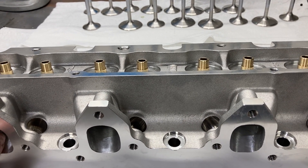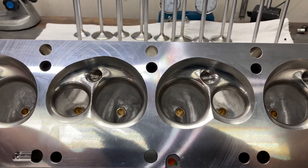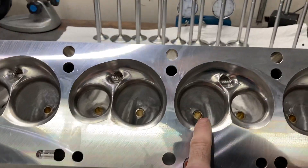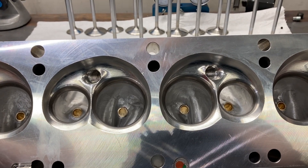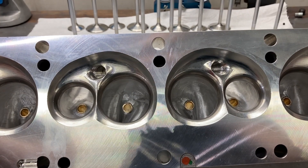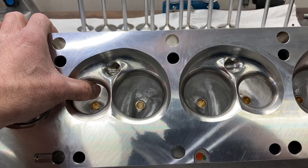Out of the box, no changes necessary. They have pretty small combustion chambers. If you're used to looking at normal FE stuff, these usually measure somewhere between 69.5 and 70 CCs. So if your current engine is set up for an Edelbrock or a BBM head or something similar, you're going to gain a little bit of compression ratio. Medium riser, high riser, or tunnel port would obviously see a huge combustion chamber volume change.